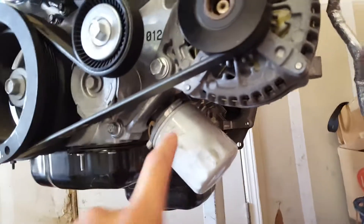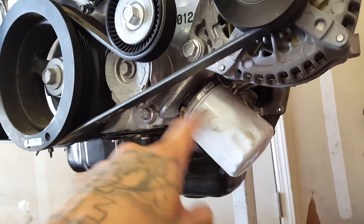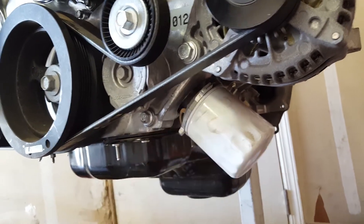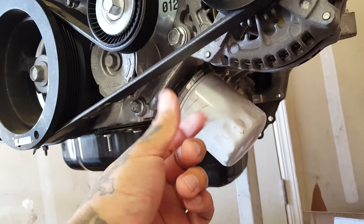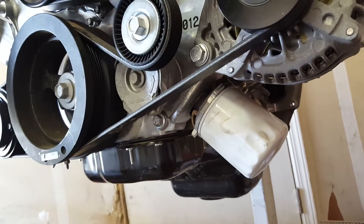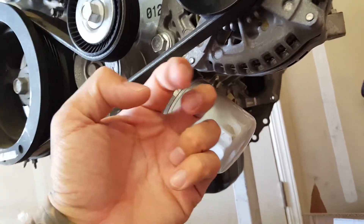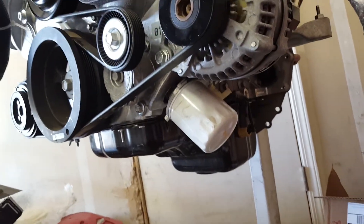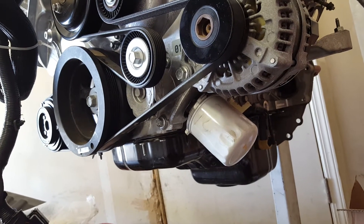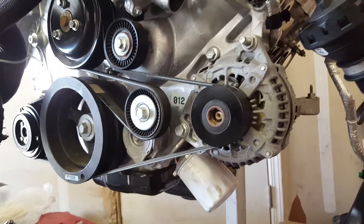You're also going to have to run an 11-to-14 style oil filter setup. You take off the oil cooler, buy a fitting from Power by the Hour for about 13 bucks, screw it in, and use the stock 11-to-17 oil filter — it just bolts right up. The oil cooler normally sticks out about six extra inches and apparently will hit something on the K-member when installing.